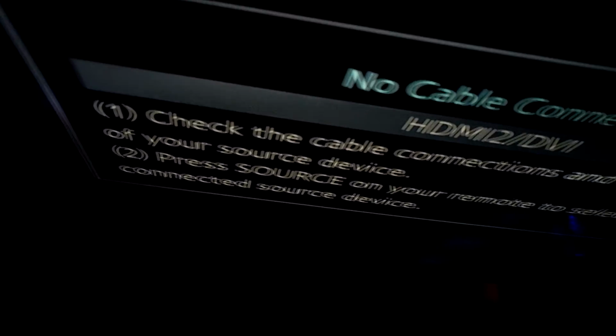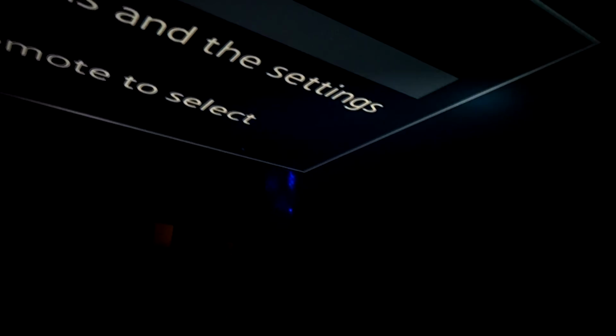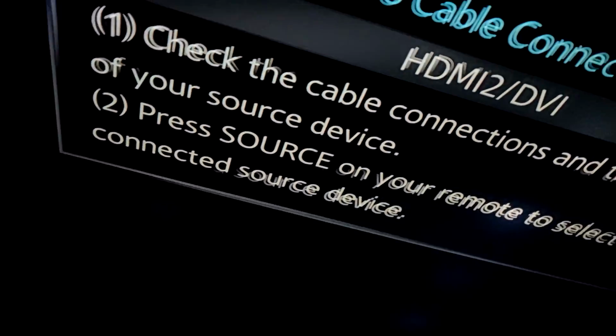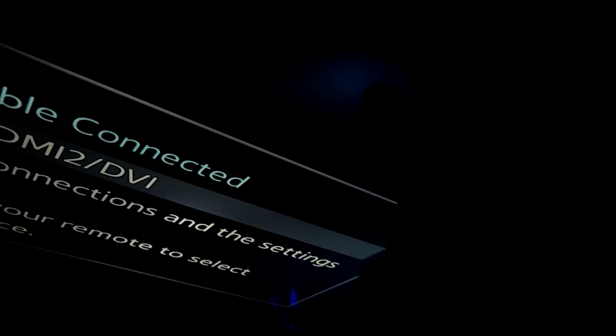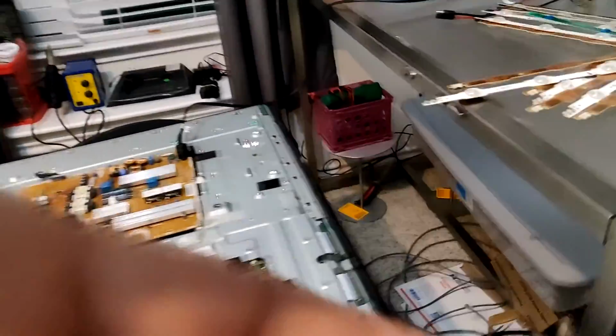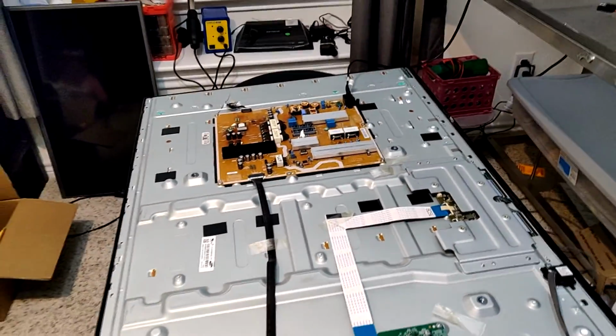So, as you can see, we have backlights coming in, and it's actually working right now, which is pretty cool. But we got a lot of hot spots here. For instance, right here where my finger is is a hot spot. Basically, a hot spot is when the lens falls off the LED. So this lens right here falls off the LED, and it's just the LED showing directly.